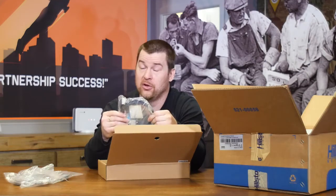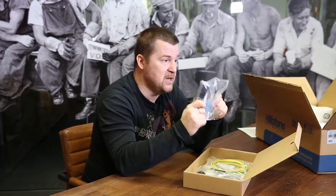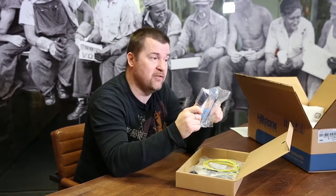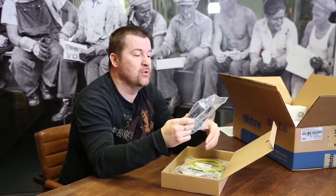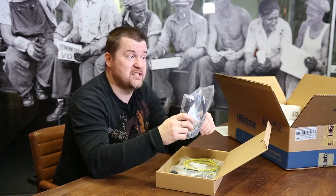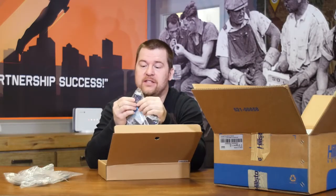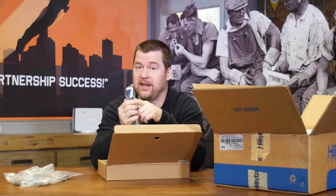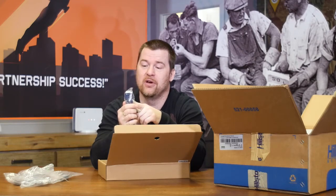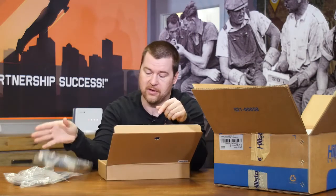If something happens to the appliance firmware — you screw it up with an upgrade or whatever — you'll use this cable to bring it back to life. My advice: keep it with the box, have it on hand, because this will be the quickest way to restore the firewall. Otherwise you'll be looking for this cable for hours because somebody threw it somewhere. Also note: there's a DB9 serial connector, which you probably don't have on your laptop anymore, so be sure to have a USB-to-serial adapter ready if you need to use the console cable.